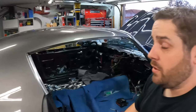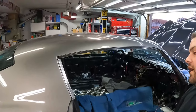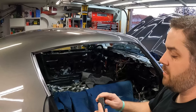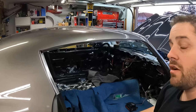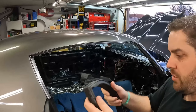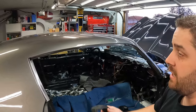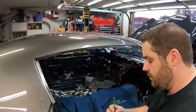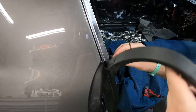Now that we have the channels mounted across the car, we're going to start getting our seal in. I'm doing a dry fit here — not gluing the weather seal in yet primarily because we're still adjusting our windows. This is actually a good opportunity: put your soft seal in while adjusting windows before you glue it to make sure it's in the right spot. I highly recommend starting two screws at the bottom corner to hold it in place.